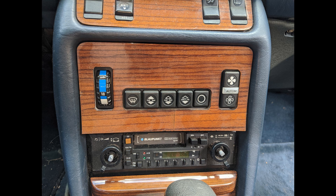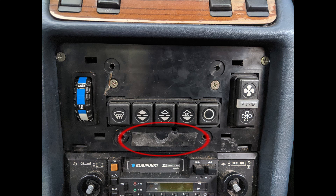You'll have to pull the fascia off of the front of your climate control unit. This just pulls straight out. You can see there's some adhesive tape down there — be gentle with it, don't bend it or reef on it, because this wood is very fragile as it gets older. Once you get that out, you'll be able to get to these two screws up here in the top corners.